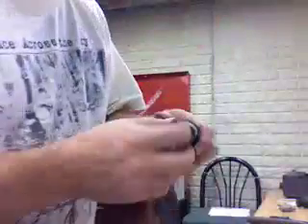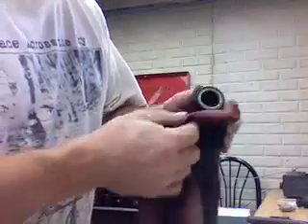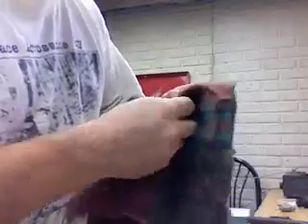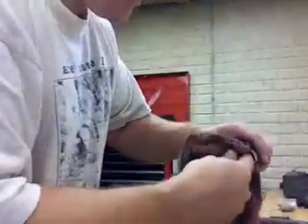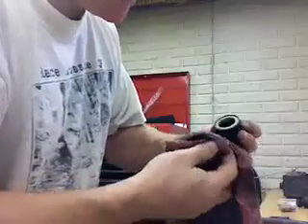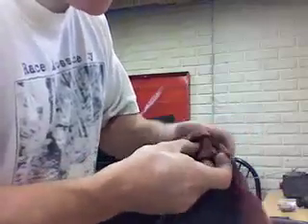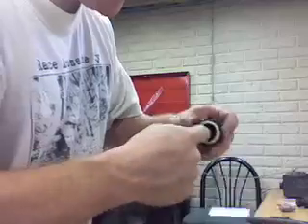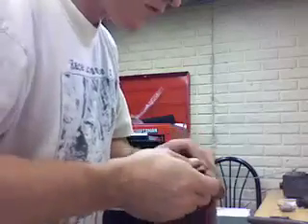This doesn't happen all that often, but it does happen. If it wasn't worn and you weren't getting side play, what you want to do is really clean this up. You can use some rubbing alcohol. Try to keep anything away from the bearing inside, because technically — if you ask Mavic — they say the bearing isn't replaceable, but it takes a lot for that bearing to go bad. So clean it up, but in this case we're not going to be using this one anymore.